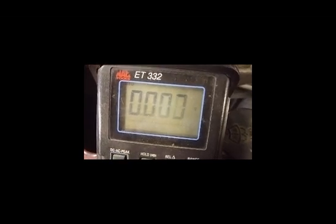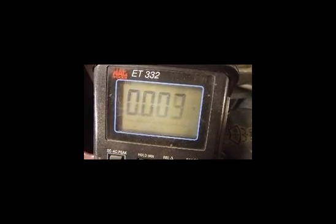We're measuring what should be O2 sensor output on the red lead. If we go back to the voltmeter, we're reading negative .074. If I rev it up, it never comes out of the negatives. If I feed it a little propane — we're going to shove a little propane in this. An O2 sensor's an O2 sensor, it's got to work.